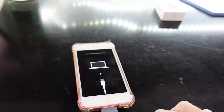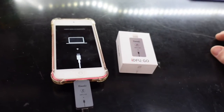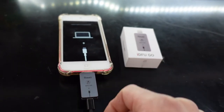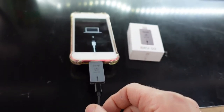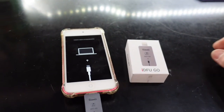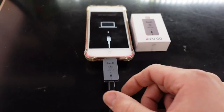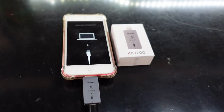So from there, if you're required to enter any device into DFU mode or recovery, you'd simply be able to turn the device off, plug this in, connect it up to the computer as normal, load up iTunes, and you should be able to get to the restore screen without having to install any weird third-party software or anything like that.